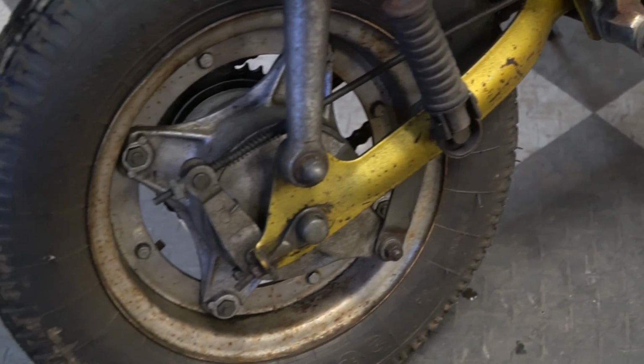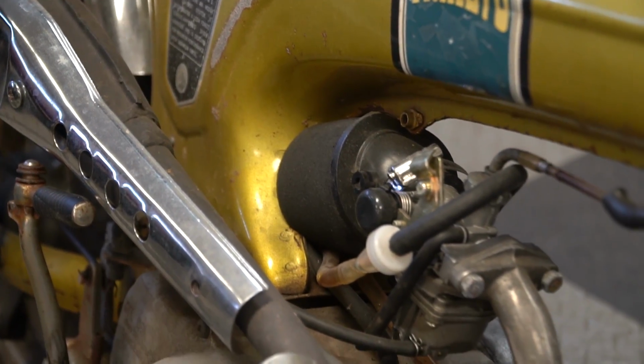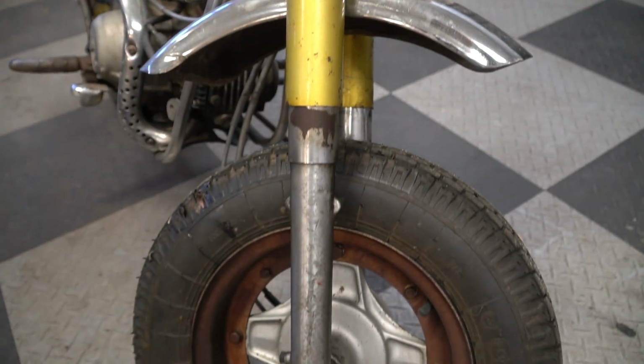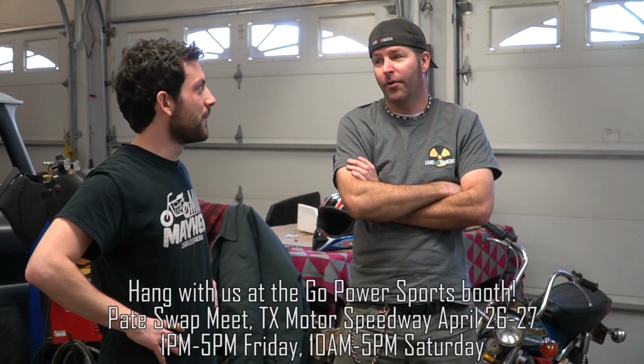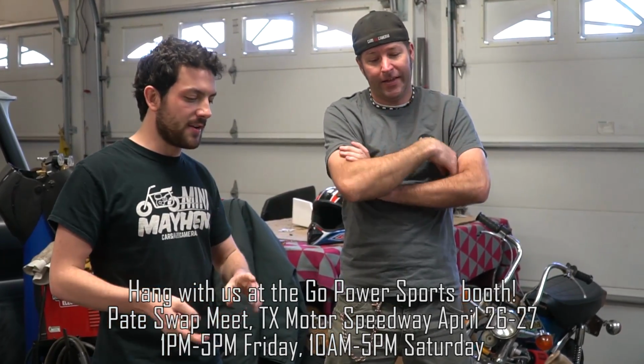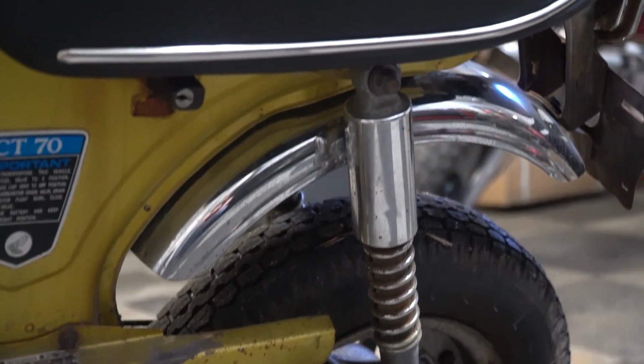Well, last year, Ike basically destroyed his original 72cc engine. You put a Chinese 110cc head on the original jug and rest of the engine, and it bumped up the compression, and the thing performed really well. Yeah. But then he rode it like 60 miles and ruined it. I don't think they were meant to do 52 miles per hour for 30 to 45 minutes with no rest. Not on 10-inch tires, not with this gearing, and not an oil cooler. No one told me not to. Right when we pulled in the driveway, the thing cut off and you just couldn't get it started. Hadn't been able to get it started since.